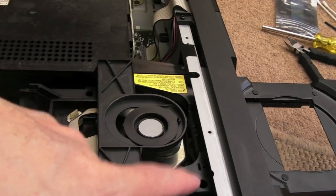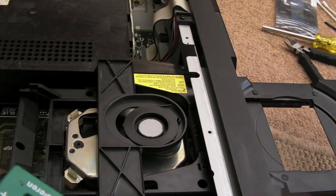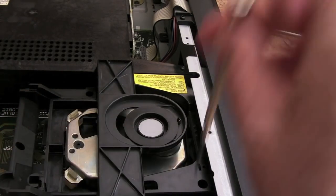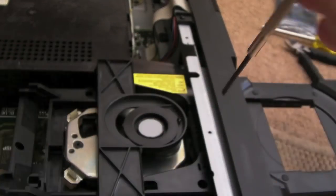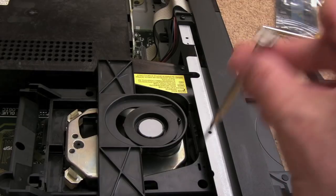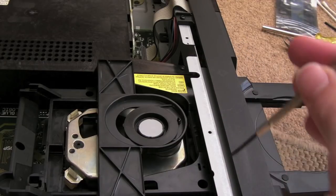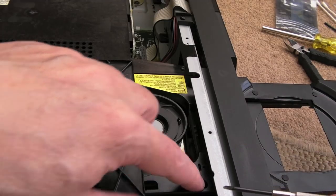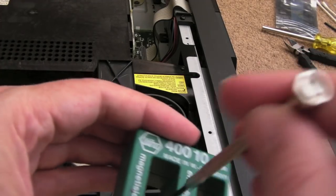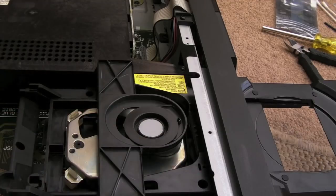So when it comes to putting the screws back into the drive, don't over tighten them, and if you're using a flat blade like I am, because I haven't got a Torx that's long enough, magnetise your screwdriver, otherwise the screws will be super hard. They fall at weird angles, and they fall inside the mechanism. They slide out, not even in the hole. So yeah, magnetise your screwdriver.